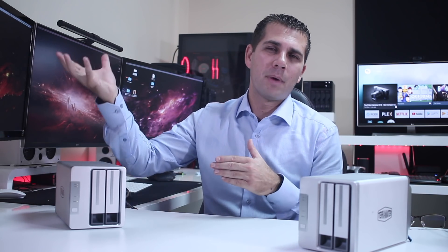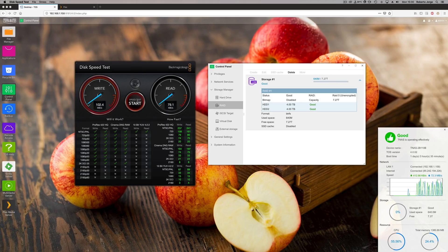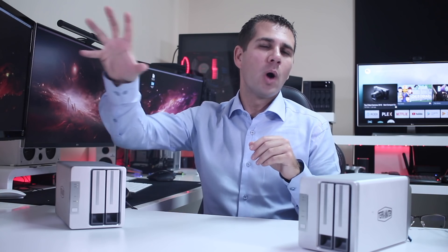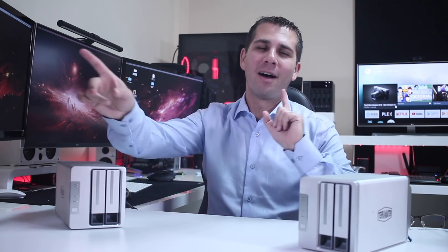I'm not sure if that's the direction TerraMaster is heading, but it would be nice to see. In terms of speed tests — we achieve more or less gigabit connection speeds, around 80 to 90 megabytes per second on reads and writes, peaking at 100 MB/s, which is the gigabit limit. With a link aggregation switch or router, we can get double that — 200 MB/s — though each individual computer is still limited to 1 gigabit.